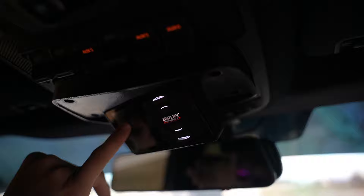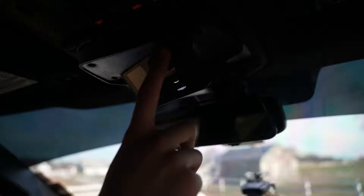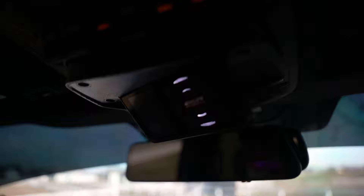You've got buttons down both sides and all these buttons in the middle. Hit this one and you can see on the screen it goes up — double-click it and it takes the truck up to maximum height. The truck can actually go higher than that, but you have to control the bags manually by clicking those right there, which controls the front left bag, front right bag, rear right, and rear left. Each one has two buttons — one to go down and one to go up. Then we can take the truck down by hitting that.